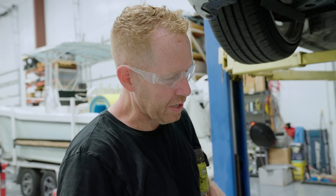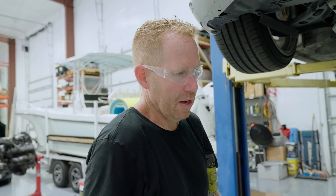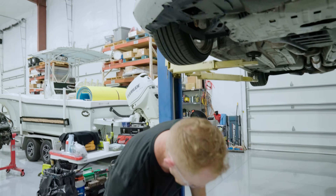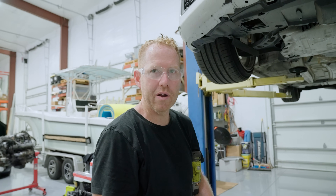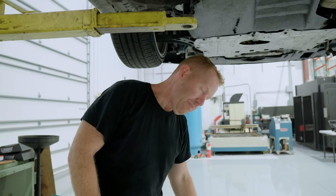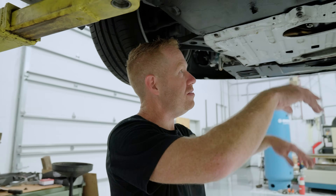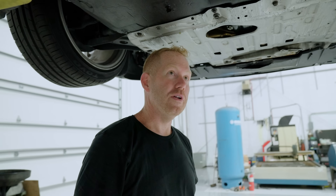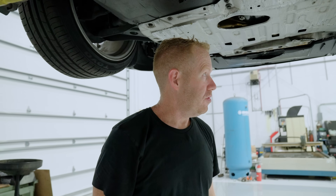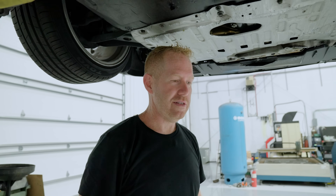It's just very weird that a completely bone stock car, completely filled with oil, would starve of oil revving out through the RPM going downhill. It's not far-fetched, just abnormal that there's not enough capacity to accommodate a proper redline. What's cool about these new Scion/Toyota design cars is they have all these panels for better gas mileage and airflow. We're going to pull down all these panels, drain the oil and fluids, and hopefully pull the engine and trans out from the top. I had an FA20 six or seven years ago and nobody wanted to swap it into anything.